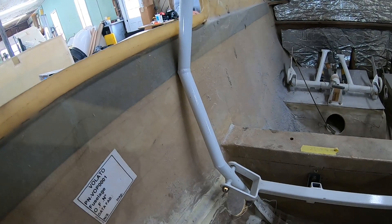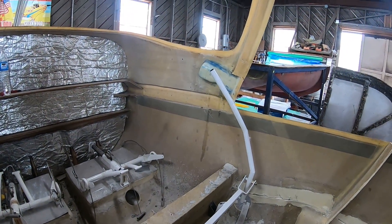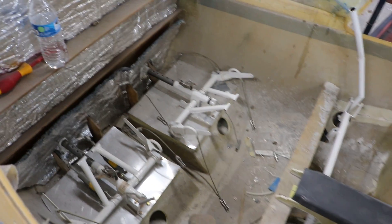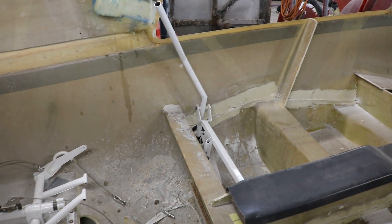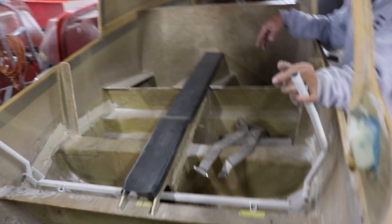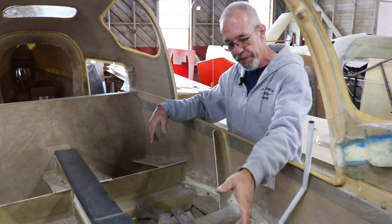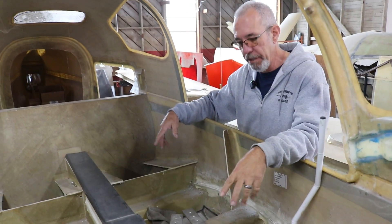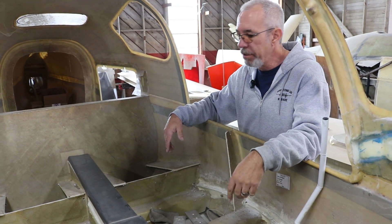On this particular airplane we're doing in-flight adjustable rudder pedals versus having just the seat move. By giving in-flight adjustable pedals, it puts you in a more comfortable position relative to where you want to be with the stick versus where you have to be due to height. This is a side stick, but you can actually also build it as a center stick — it will take the control system from the TR-4 if you choose to have the stick between your legs. With the center stick option, the seats become non-adjustable because the stick won't move with the seat.